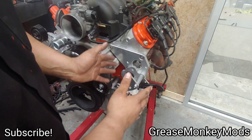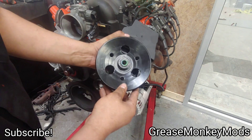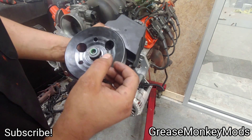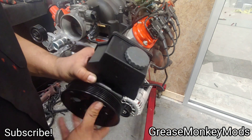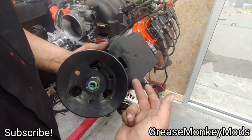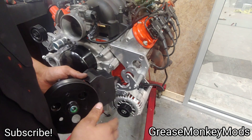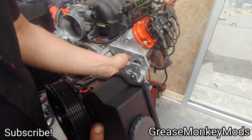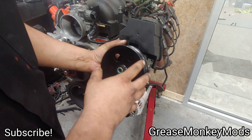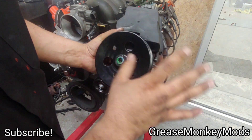We can grab the pump and install it as a unit. Your factory pump comes with a really big solid plastic pulley, but this Dorman one has holes machined into it so you can access the mounting bolts, and it's metal versus plastic. I've actually seen factory plastic pulleys explode like shrapnel in the engine bay. I found this cheap Dorman pulley for only about 20 bucks — I'll link that in the description, along with the pump, alternator, and brackets. I got all this stuff off Amazon. Since this pulley has holes to access the bolts, I can install and remove everything as a unit — otherwise I'd have to remove the pulley just to get to the bolts.